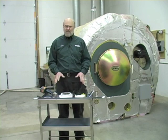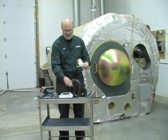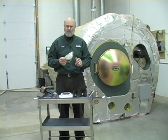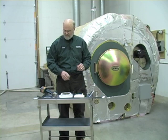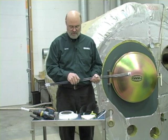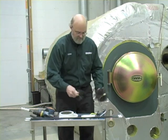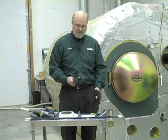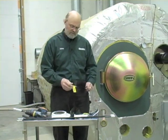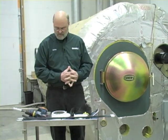In front of me I've got some of the basic materials you'll want to use. Safety is always first — if you don't have glasses you should wear safety glasses, and you should always wear a mask because you're going to be dealing with a lot of fine particulate matter. This is the model 2000 we're doing; the model 1500 is a couple feet shorter. We have three three-foot fiberglass rods that go with the cleaning brushes. There are two different size brushes: a four-inch brush that does the lower two clean-outs and the motor flue clean-out, and a five-inch brush that does the last run that goes to the actual chimney.